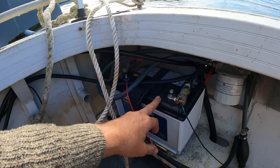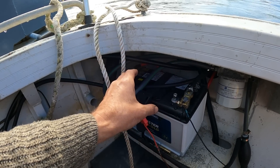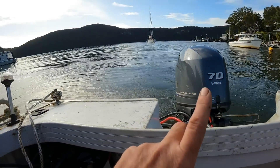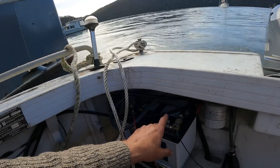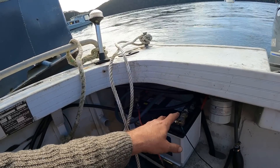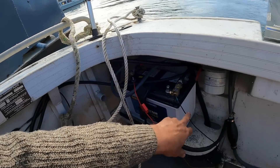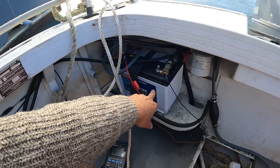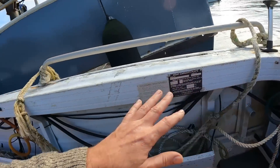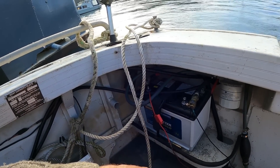This battery's been on a mains charger overnight, so I'm just going to quickly check the voltage now. Then we're going to look at whether it's charging from the outboard — whether the regulator rectifier is working — because sometimes when they fail they can also draw current. Then we're going to take the negative off and do an inline current test to see if there's a parasitic draw. The only things connected are some very short wires to a bilge pump, which wasn't even connected at the time, and the ignition was off. So let's see if we can figure it out.